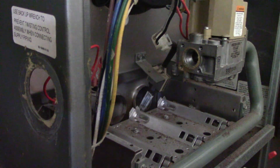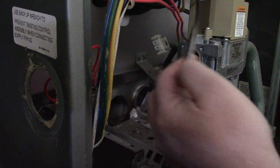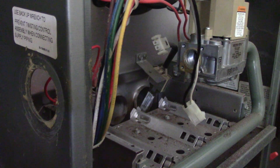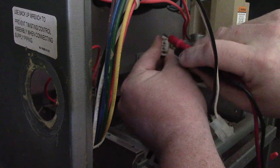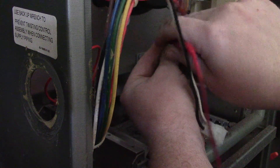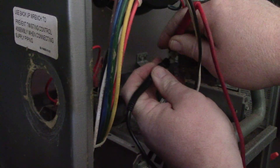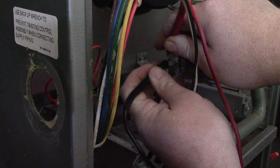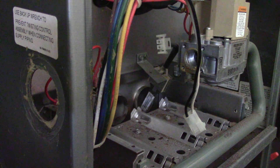When you go to troubleshoot it, this is the plug that leads to it. Just disconnect it there. You can take your meter probes and put them right in there — just like this — make sure you're touching the metal there and get an ohms reading on it. OL is going to mean bad. If I remember right from service manuals, at 70 degrees, if you're over 40 ohms, your igniter is good. If you're under 40 ohms, it's going bad.